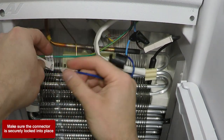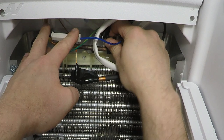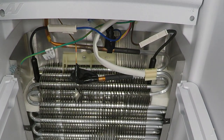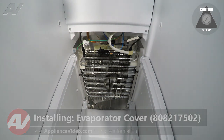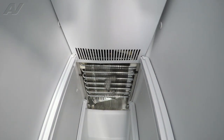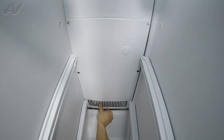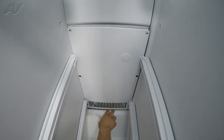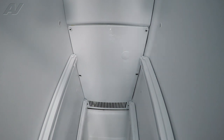Let's reinstall this side and slide this back on the backside of the evaporator. Now we can reinstall the evaporator cover. When reinstalling your evaporator cover, we will bring it in through the top and start to drop it back behind our rack slides here. When you get it down to the bottom, you want it to go behind the tray so that you ensure the water goes down. Next, let's start to reinstall our screws.